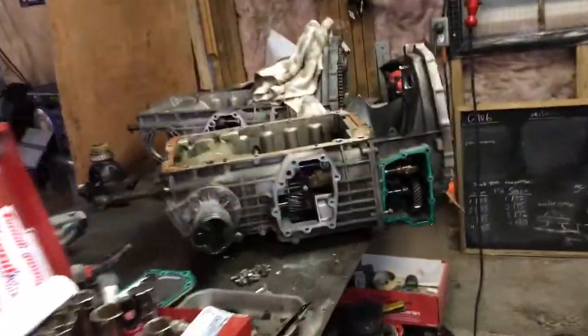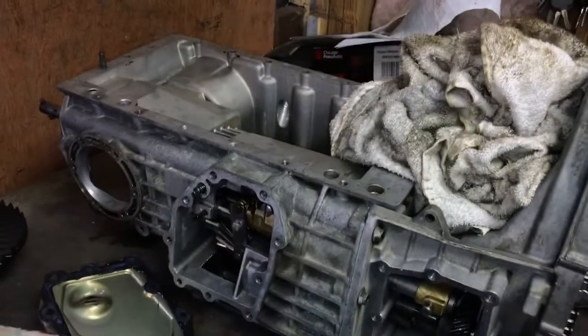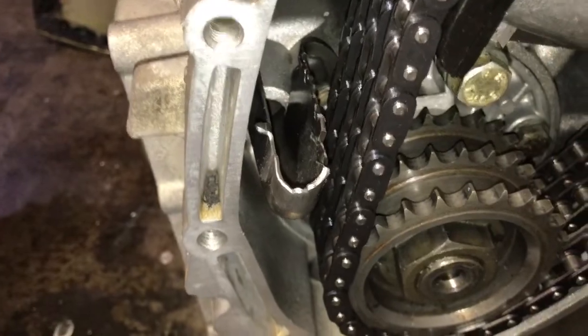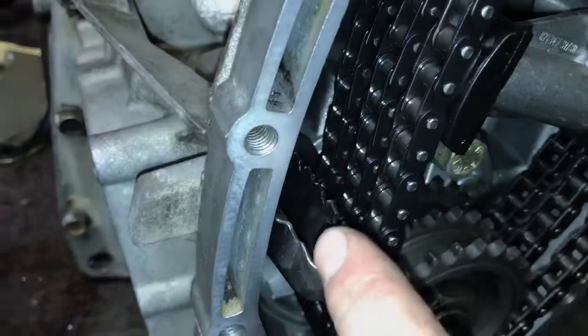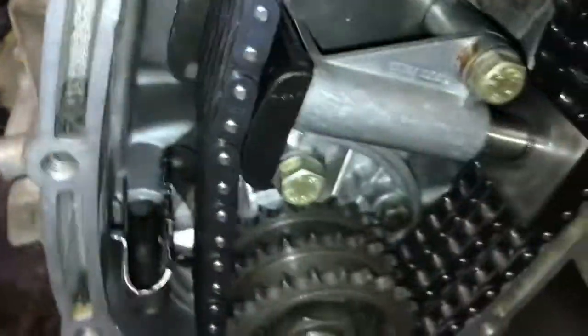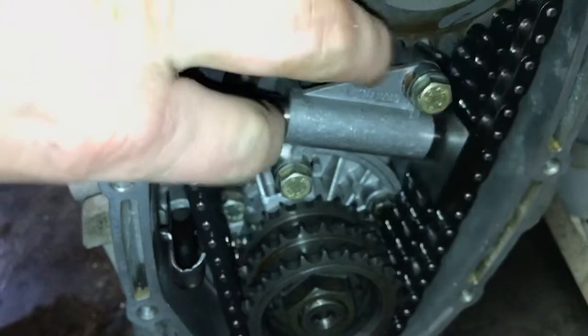In addition to doing the head swap, we've got the gearbox situation. I took that gearbox off of the old engine that's been sitting on my floor for the last couple of years. In a previous video I had a look at it and decided it wasn't really in the best shape. Looking in the front primary housing, the chain looks like it's been eating the oil cup - a little oiling piece that flings oil into the cup to keep the level in the primary case correct. For some reason this chain is able to hit it - I think the tensioner just outright failed.